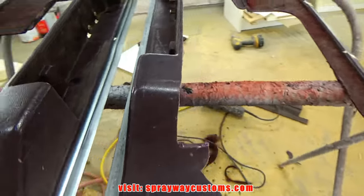After I had sanded down my edge where I put the fiberglass filler, I came back with some regular body filler just to feather edge it on out. And I saw some more imperfections that I just filled. Just waiting on it to dry up, then I sand this down. Then I think we'll be ready for some primer. Also, I gotta cut this section out from the back side. I'm gonna cut it out here.